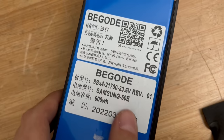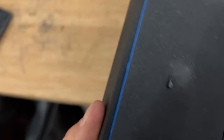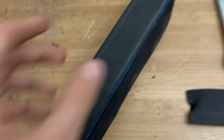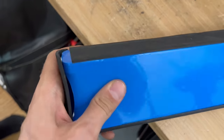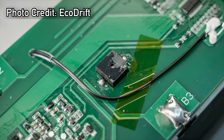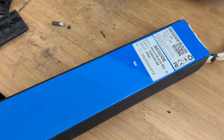When it comes to the battery pack itself, I like that it is thin and there are no cell positives and negatives touching next to each other, which is usually the case with those 900 watt-hour packs. These are Samsung cells, so probably no issues like we had with the LG packs. There is supposedly also a buzzer inside and a temperature meter, so if something goes haywire, maybe the packs will buzz or beep. And this pretty much concludes the teardown of the Begode Master.